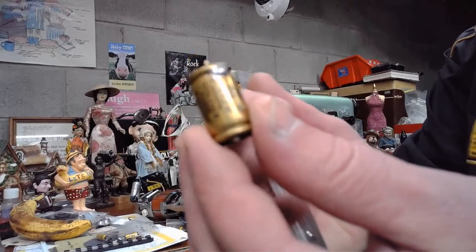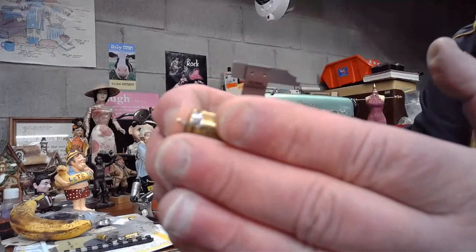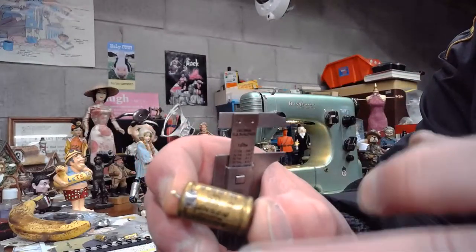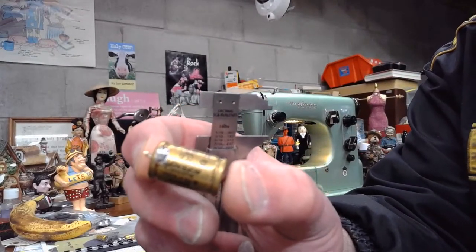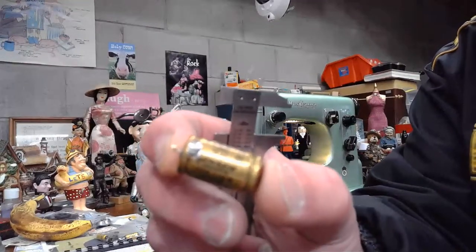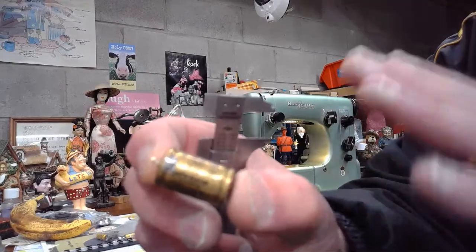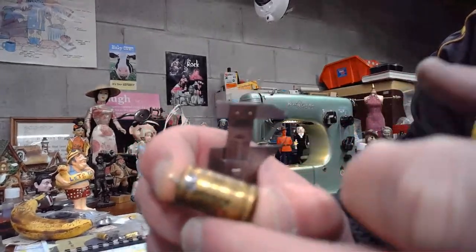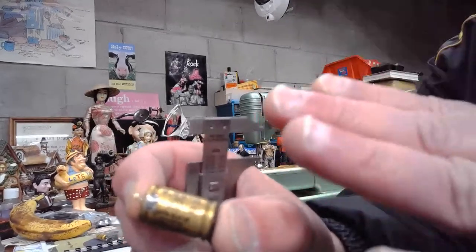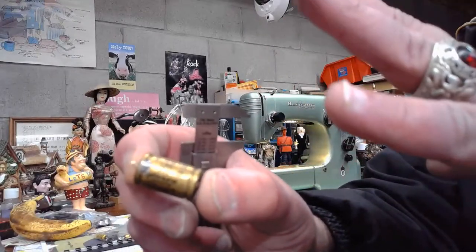It's almost acting like a dam on a water source, and it's holding that electricity back like a dam. How much energy from a standpoint of volts do you think this little gadget can hold back in that foot controller until it releases it evenly and in a controlled manner to the motor, which it didn't do? It was like the dam broke, and that energy that had been built up in here shot to that motor, hit that capacitor, and that capacitor in Patty Lander's machine went boom.